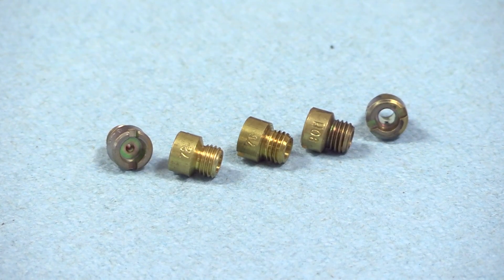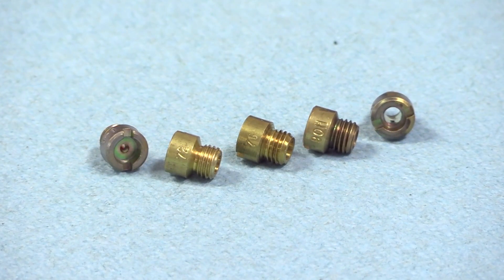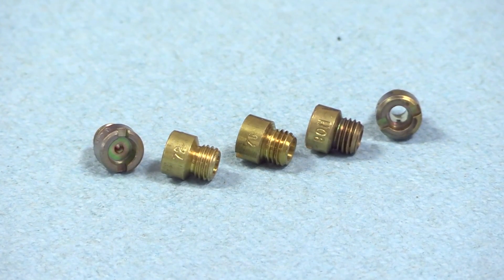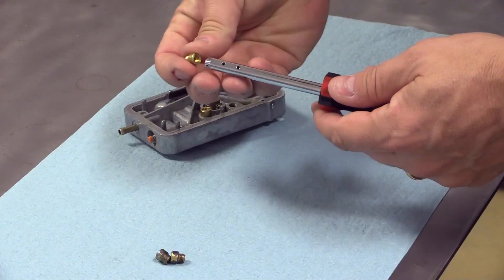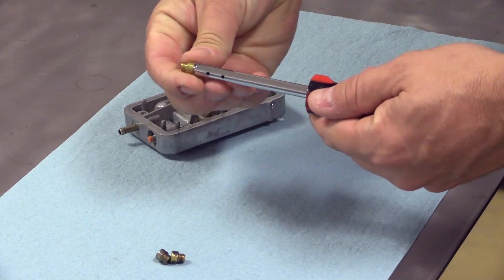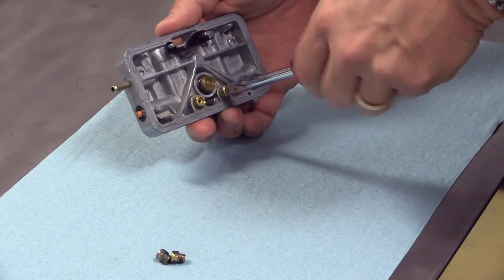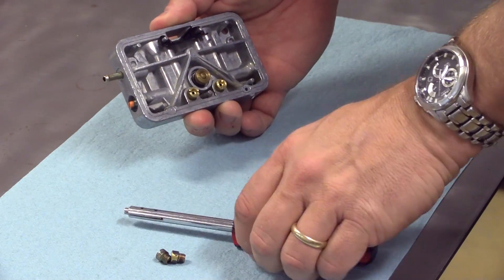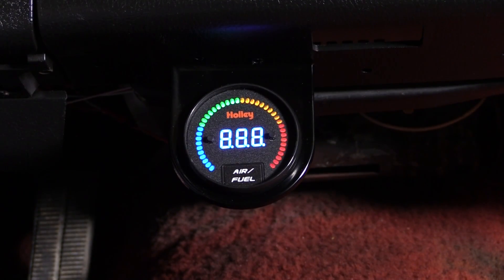Here's a selection of jets. They meter the amount of fuel going through the carb by the size of the hole. Holley's jets are all marked with numbers to make life simple - the larger the number, the larger the metering hole, and the more fuel that gets mixed in with the incoming air. Installing a new jet is simple: just place it onto the tool and thread it into the metering block. Make sure the jet is good and snug - you don't have to use gorilla force to tighten it down. Now put your carburetor back together and it's time to go for a ride.